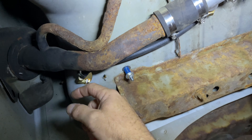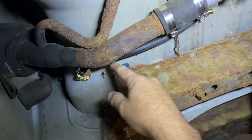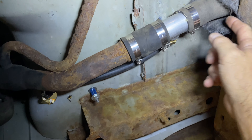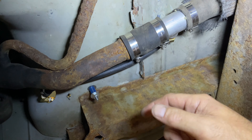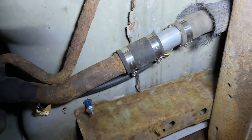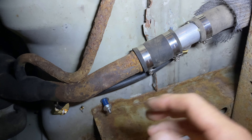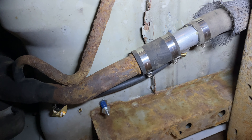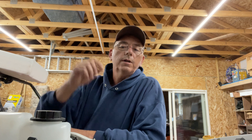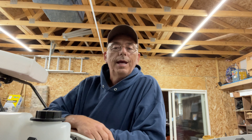The operation is simple: when your upper auxiliary tank is full, you open the shutoff valve and fuel drains by gravity down through the rollover valve, filling your main tank and continually keeping it topped up. Really easy install. If you got something good out of this video, click like and subscribe, leave a comment, and as always — safe travels, and I hope to see you on the road.